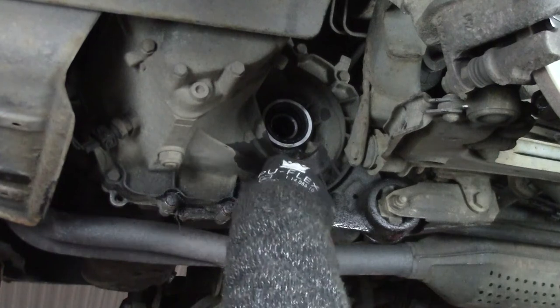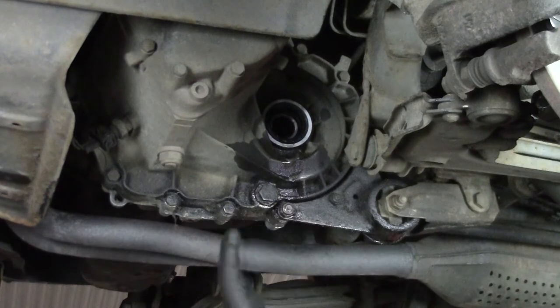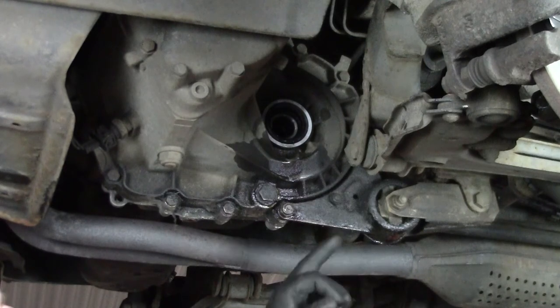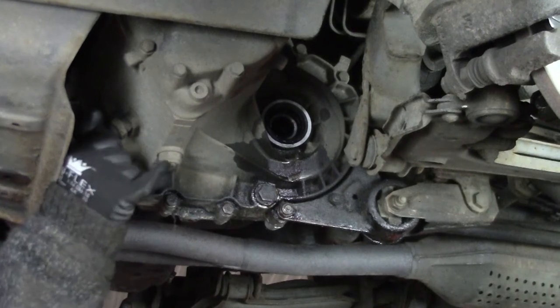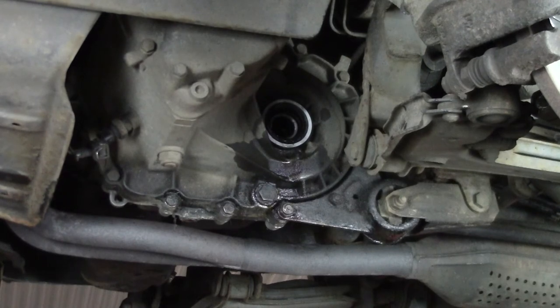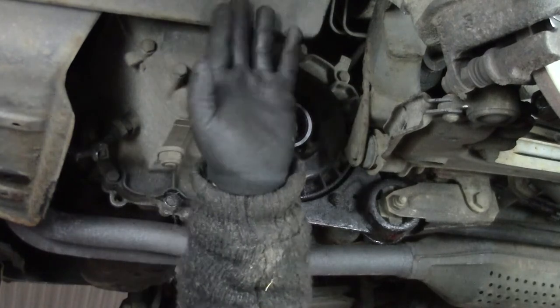The oil is all drained, so we can put back the plug. I did take a bit of a look underneath the car at all the things I need to loosen up. One of the things is the rear transmission mount, so we are going to at least remove that one. And there is a clip here, I think it's the reverse plug, that's out of there. Also, I'm going to remove these splash shields, and there is a shield right here.